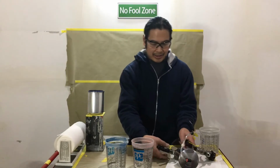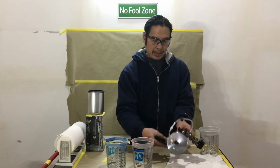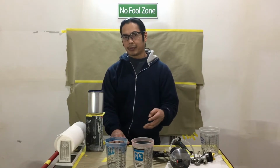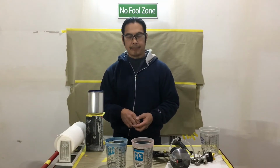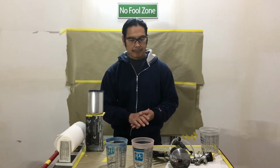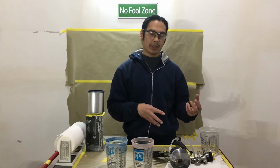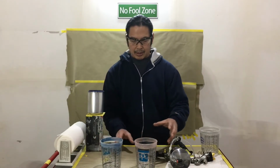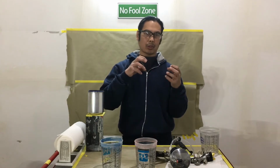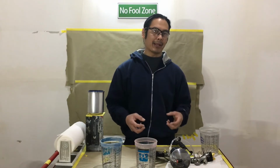All right, so now let's get back to this. When we're using a pressurized cup, we can use a smaller size tip. And a variety of clear coats are going to be 4-1, 3-1, 2-1 mixes, plus 5%, 10%, 15% reducer. Now, when you start to think about those different mixtures, what's the difference between a 4-1 and a 3-1? Well, this is what I was taught: you might have compacted isocyanates, meaning the isocyanate molecules are like a bunch of BBs versus a bunch of marbles, or however you want to comprehend that analogy.